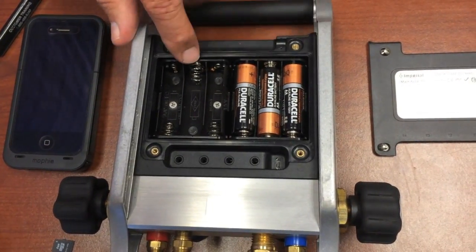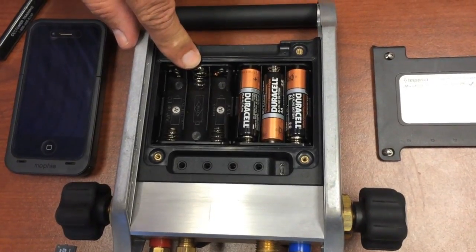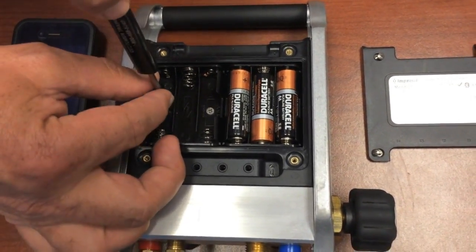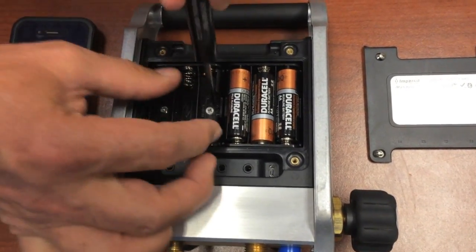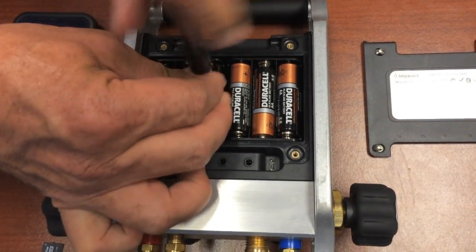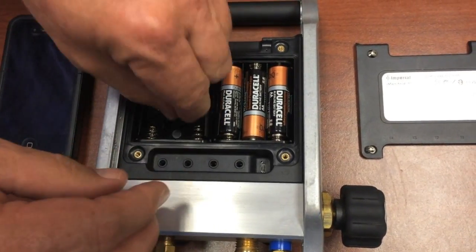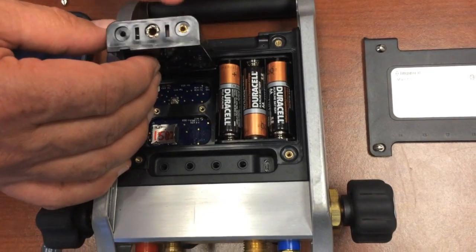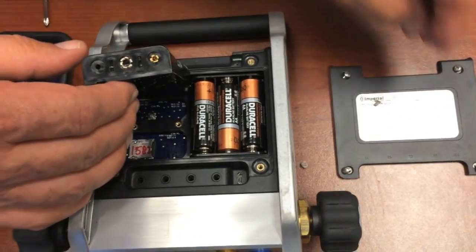In order to do this, we need to pull out three batteries from the left-hand side battery compartment, and then take out the two screws that hold that battery holder down. Just loosen those two screws up, lift up on the bottom of the battery compartment, and you can dump those screws into your hand and catch them. Set them aside on your battery door.